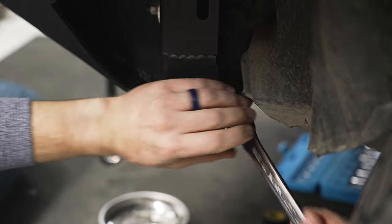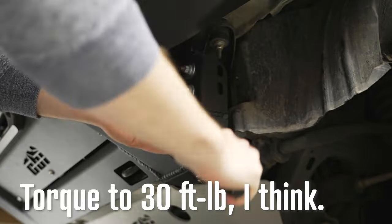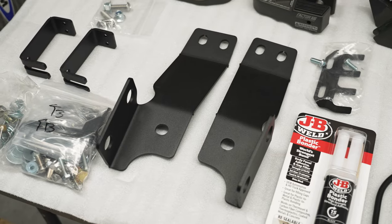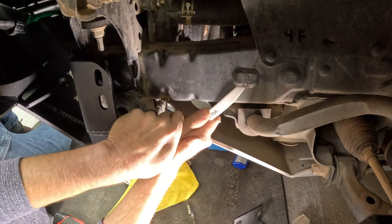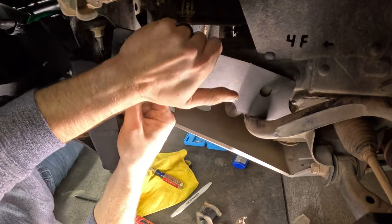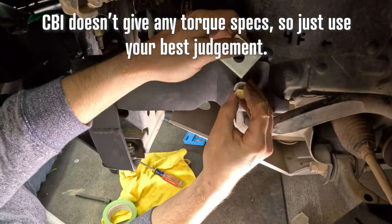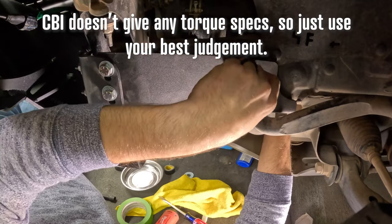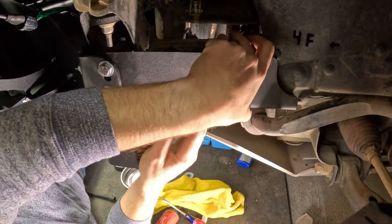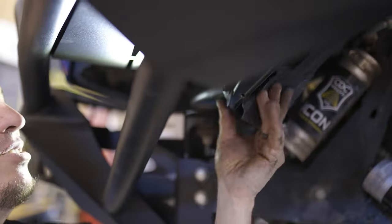Tighten the bottom bolt down when you're happy with your alignment, then tighten the six original 14-millimeter nuts that connect the bumper to the truck. Torque specs weren't included in my instructions and were hard to find, but another manufacturer said 30 foot-pounds, so I did that — if that's right or wrong, please leave a comment below. Installing the side brackets is a cakewalk: remove the plastic frame cap on each side, remove the two 12-millimeter sway bar bracket bolts, slide the side bracket into place and secure with the supplied hardware. The large grade-8 bolt that goes through the frame uses a large square washer and then a lock nut — I also used Loctite on all these fasteners. Reinstall your sway bar bracket bolts on each side and torque to 30 foot-pounds. You'll also need to cut your wheel well liners — I unfortunately lost that footage, so here's a quick look from CBI doing that on a different bumper.